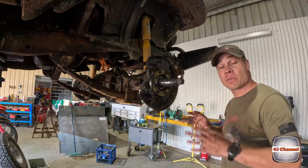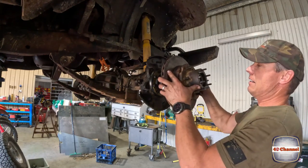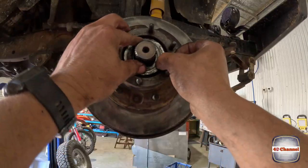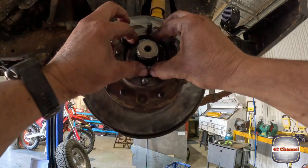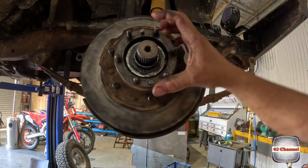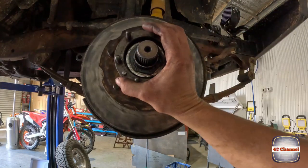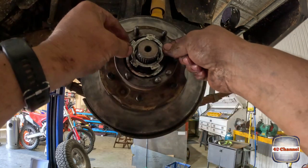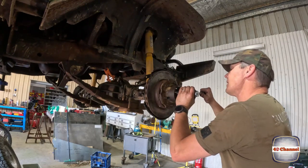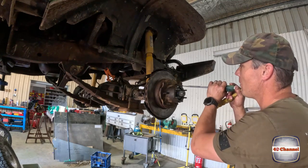Chuck in the wheel hub with the bearings that we all preset back at home. I'll put a little bit of grease, just run around that seal there to help it all go in. Carefully slide that on to hold that bearing in place, on our backing plate — slide that on. First retainer nut — just do it up nice and firm by hand, see how it moves, make sure there's no back play, and nip it up nice and tight. Make sure it spins freely — if it's not spinning freely, you've done it up too tight. Locking washer and our last retainer nut — lock it in, make sure it spins freely. Fold those tabs over to lock them in place, just as we normally would have with the hub rebuild.